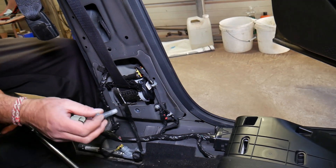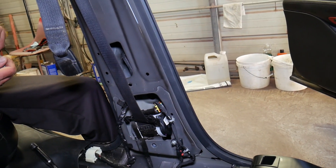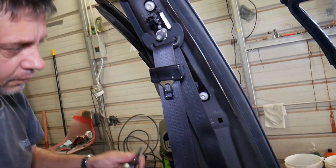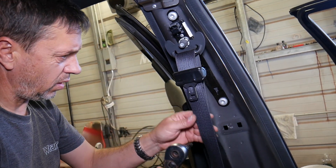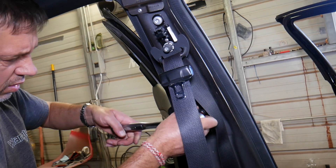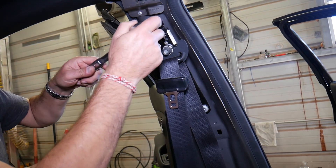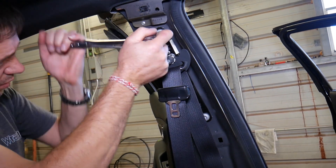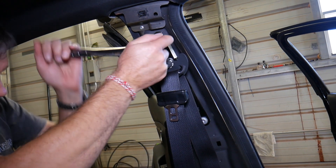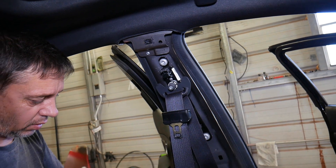These things are part of the airbag system — super dangerous — so be careful not to cause an explosion. Make sure the car battery is disconnected at least one hour before doing the repair, and avoid heating the belts. We have two more bolts on top that need to come off. Those will probably be a little looser than the bottom one, which was extremely tight — we haven't seen one that tight in a long time.